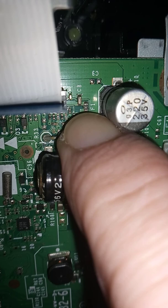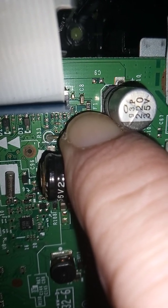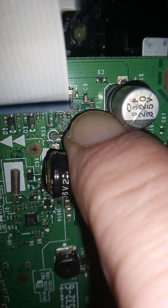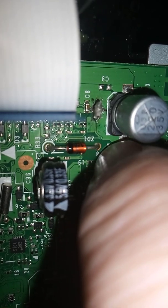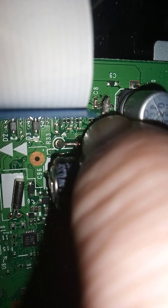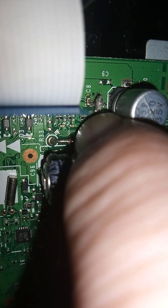Since these machines have now hit six years old and the customer is probably only expecting another two to three years out of the printer, you can simply unsolder the fuse and solder a small bridge — a little blob of solder between the two points. This still makes the connection. We know it's now drawing about 2.2 to 2.3 amps.